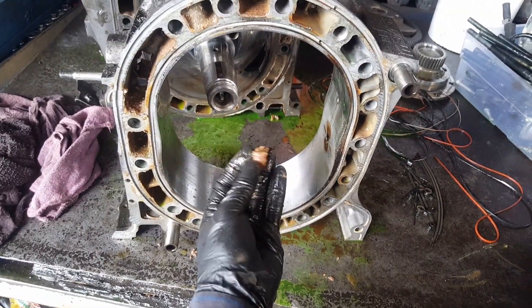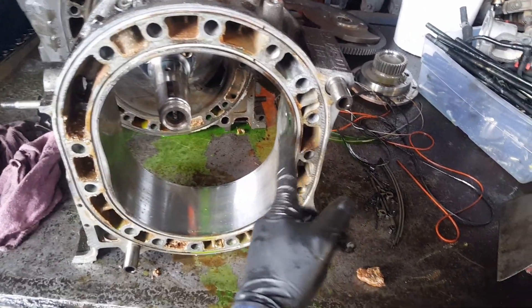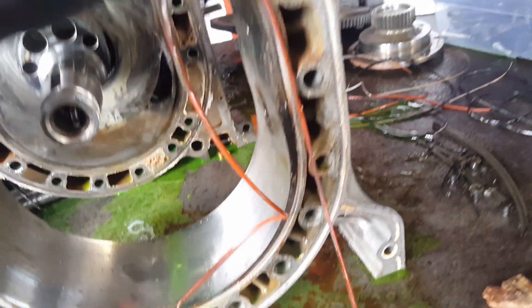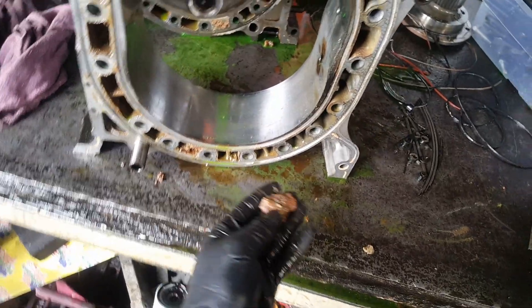The only fix is opening the engine and replacing the seals. So save some money and don't be stupid — don't add any of this crap. Because once it's wasting water, you either have a cracked iron, a cracked housing, or a blown seal. Once it's already blowing water, water is going inside the rotors. See this little rubber? That's what seals it. You can see right there — black spot. It overheated and started pushing water.